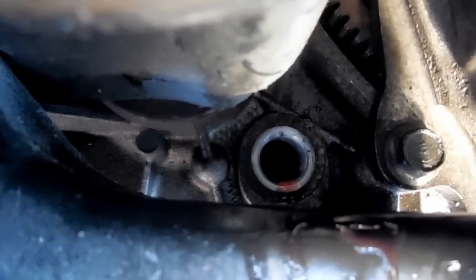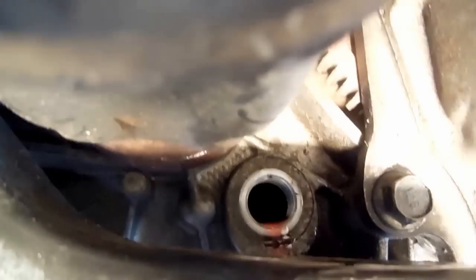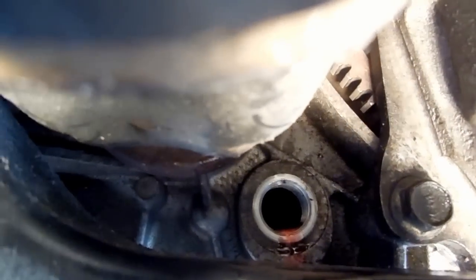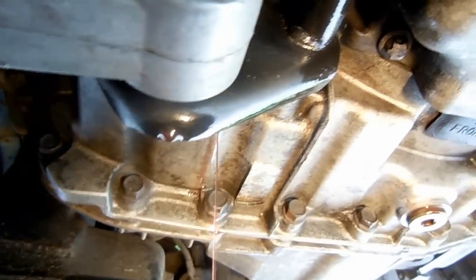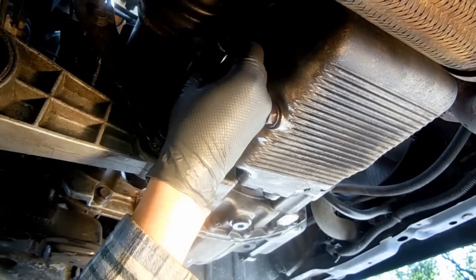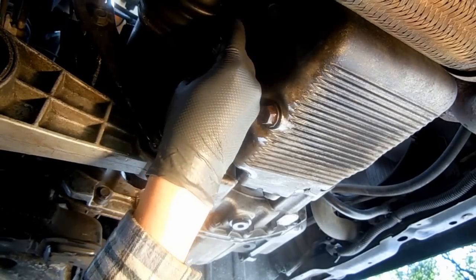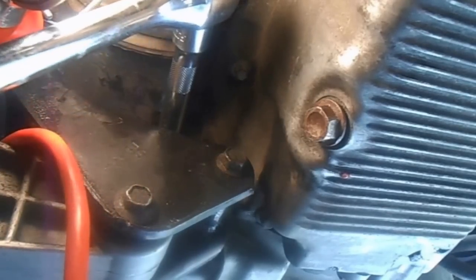We know we're at the right fluid level when fluid starts dribbling from the hole. If the car is level as it rests on jack stands, that means the level of the oil is also correct. Replace the fill plug. Torque it to specifications, not too tightly though. The threads are aluminum.